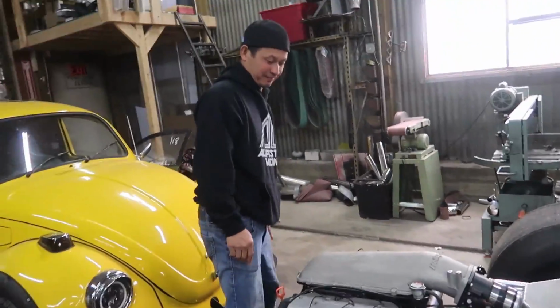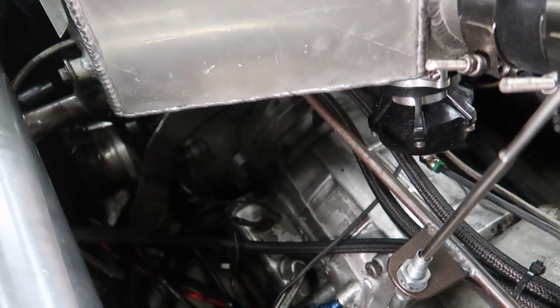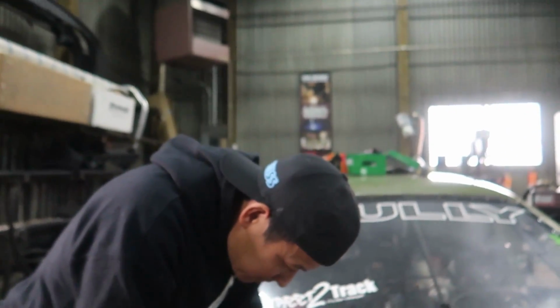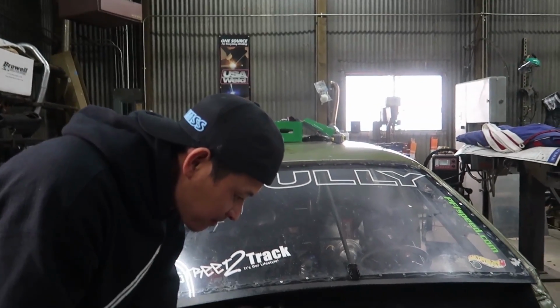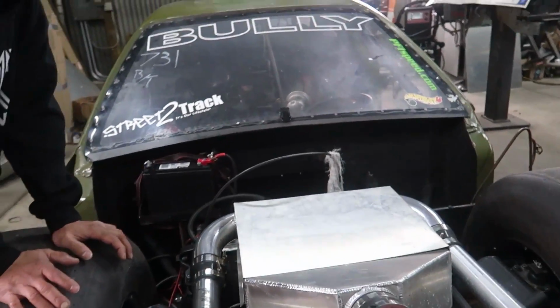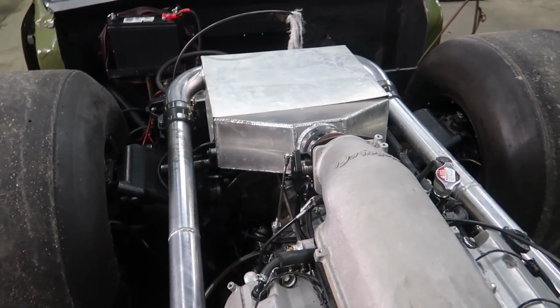So Fong showed up and we're gonna investigate this electric shift from TransKing. So it's those two wires. We just got a power and ground. And I've seen two forums. One says we gotta keep power to it the whole time to keep it in low gear, and another one says take it away. So we may just have to jack it up, put it on jack stands and drive it and try it. Cause I'm not sure, but if we're driving in the air, low RPM, we could upshift, downshift and just figure out what it's supposed to have and how to reset it all.